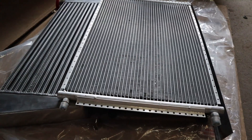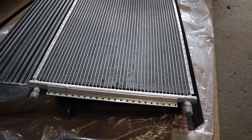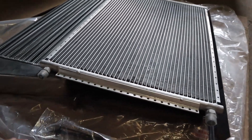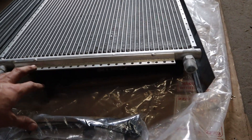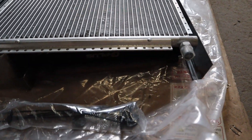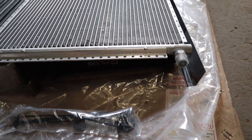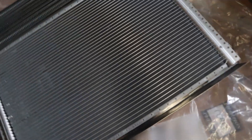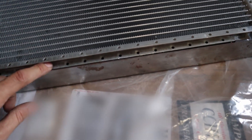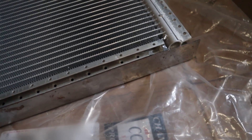It kind of creates a void. Now the way this is set up in the first place is at an angle up front and uses actually two grills on the hood — one on the top and one on the very front. What I'm planning to do is mount the AC condenser just slightly at an angle on top of that, and then the AC fans will go on top of that. The fuel cooler and power steering cooler will be underneath there but still easy to access for the fittings. I have a piece going across the bottom, and I'll create little tabs that the AC condenser will slide into and bolt up to.